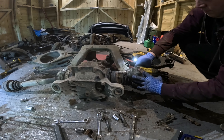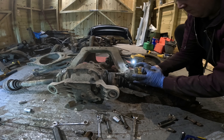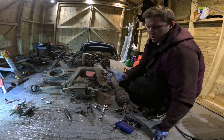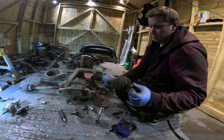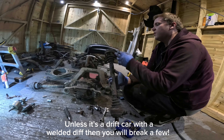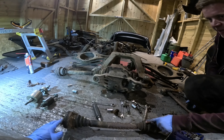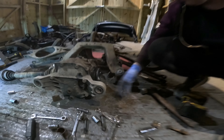The diff itself - pretty straightforward. If you want to refurb it, give it a wire wheel, there's a gasket under the cover which you can replace, and the cover is aluminium so you can soda blast or vapour blast it. Put new bushes in there. This one looks like it needs a seal on one side, and being that I believe it's an LSD - because the car's a factory sport - you'll probably need some new clutch packs inside. We'll look at that in a separate video.